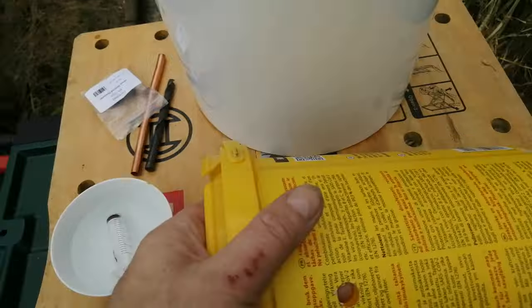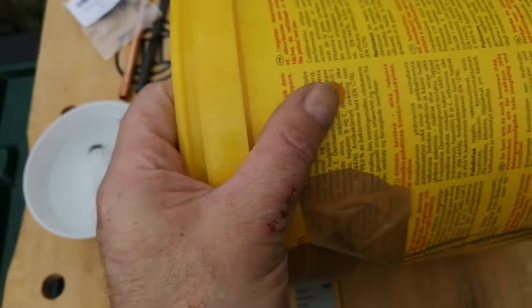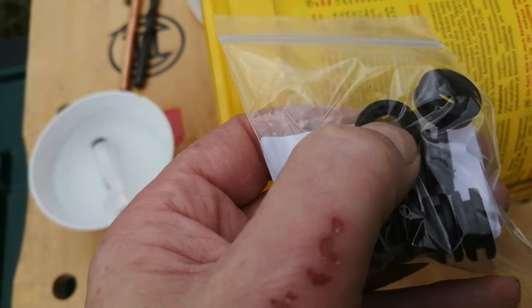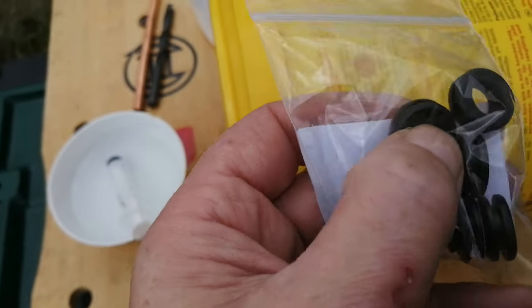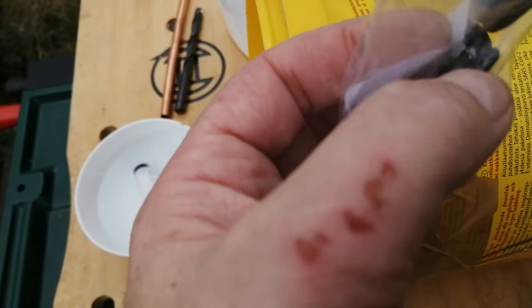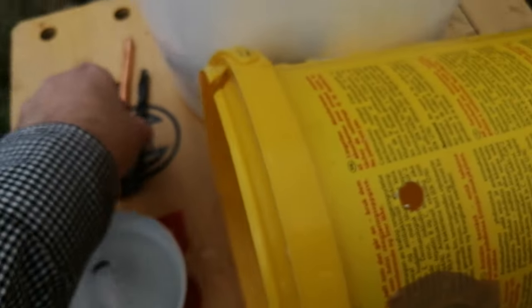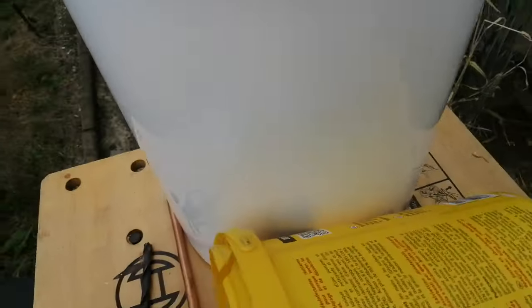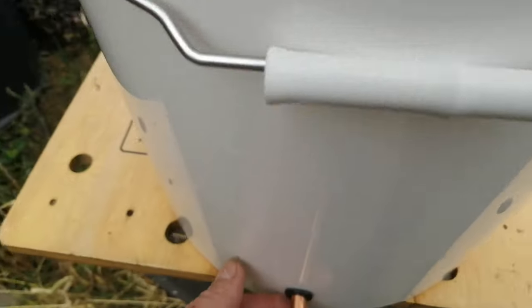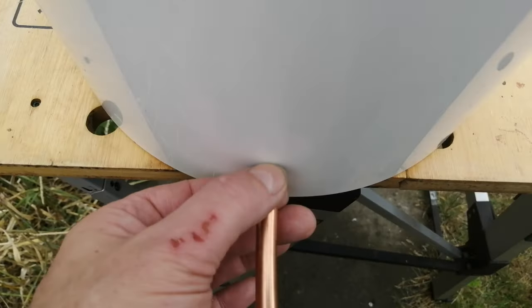What you need to do though is do a test hole. This is 11mm. These grommets are 10mm diameter. They say 12mm hole for this piece part here, but I've fitted them with a 10.5 drill bit. And as you can see, no water leaks.